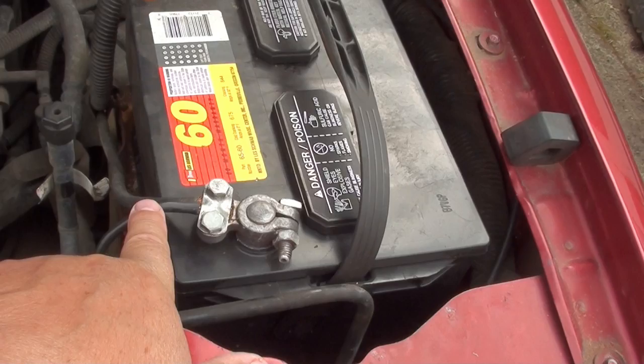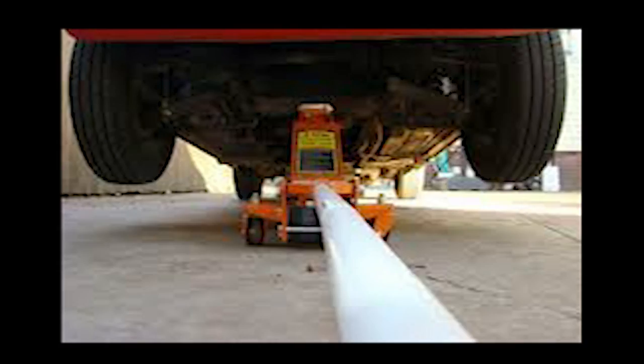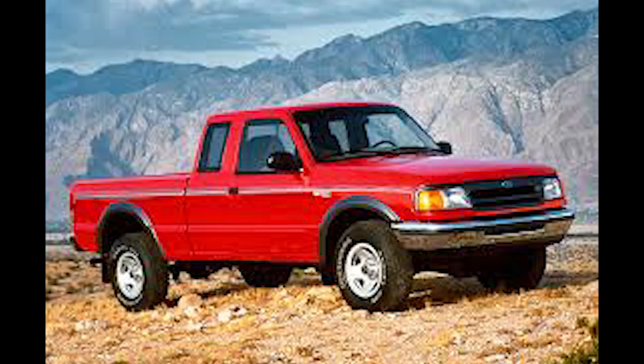We talked about the battery and the alternator today. One thing I left out is the starter. Crawl down there with a creeper or jack it up and look at your starter — make sure the ground and the positive connection nuts are tightened. It's just for insurance purposes if you have the skills, tools, and time. The starter has nothing to do with the charging system, but we're making sure all ground wires connected to or powered from the battery to the body are well connected.